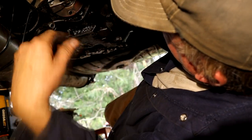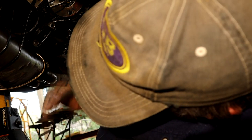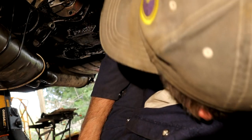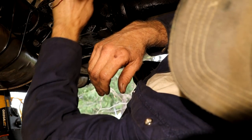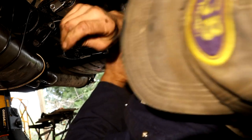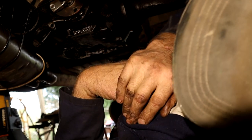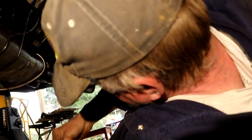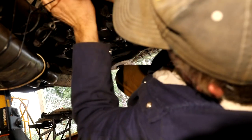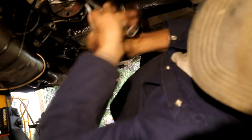So I'm going to stop right here and call it a day. We're at about 17 inch-pounds of rotational torque with the brake pads off and axles level. It feels good — there's no play. I've been making marks on the nut with a pen to track my progress and see the marks moving, so everything was very gradual. I think we're good to go. Let's get this off, get it all back together, put oil in it, and keep our fingers crossed.